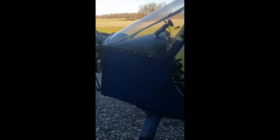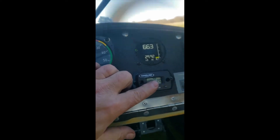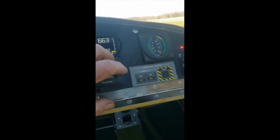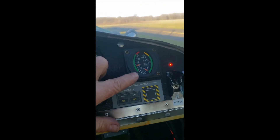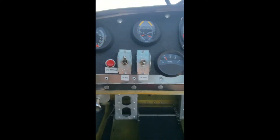Hi, welcome back. Got my engine running again this last weekend. Here you can see I'm doing an idle run-up right now. Cylinder head temps looking good, right where they should be. RPM about 1600 — it's a little high, I'm going to tune that. Oil temp and oil pressure looking really good, rock solid. This new engine is looking fantastic.